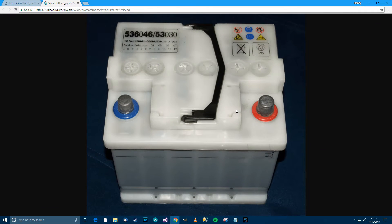So what's happening here? Inside your battery there's a lot of liquid, and this is sulfuric acid mixed with water — which is still sulfuric acid really. What happens is the water evaporates and leaves a concentrated amount of sulfuric acid. You have these caps here to top up with water, and the volume should sit between the min and max lines. The electrolyte, as it's also called, which is sulfuric acid, is extremely corrosive.